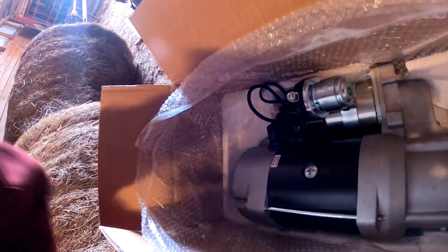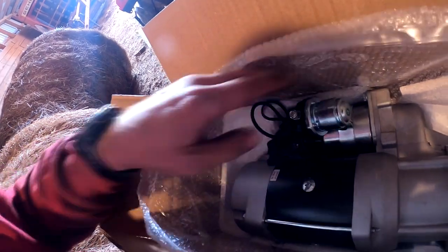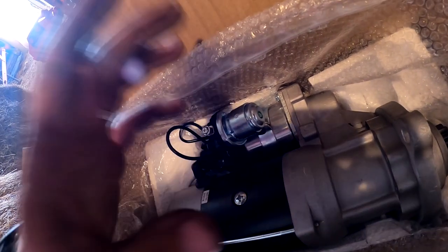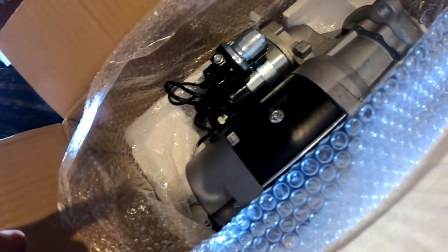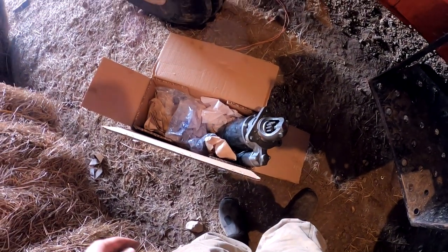The other thing it has is an IMS — which I can't remember exactly what it stands for, something magnetic system. Anyway, there are a couple of different things this has. The motor on this one is a much smaller motor, but it turns much faster. Then it goes into a gear reduction, which obviously brings it to the normal rotation speed that this engine requires to start, but it does it with less amps and less wattage. This one uses 7.2 kilowatts, that one uses 12 — I think 12 even or 12.1 kilowatts. Much different draw.